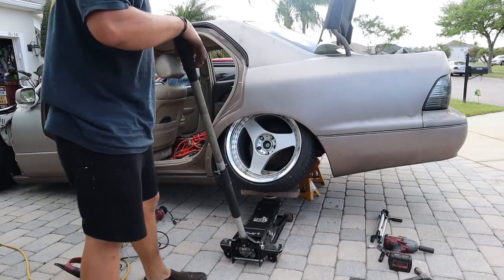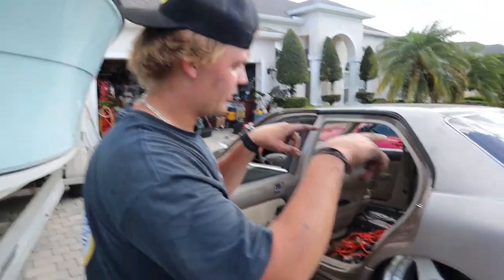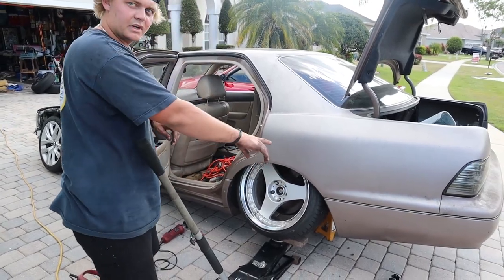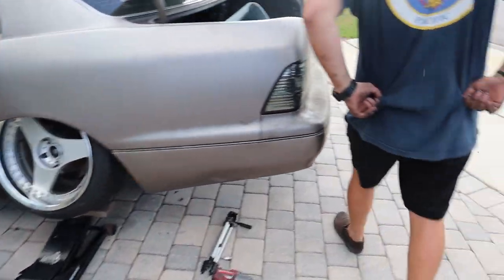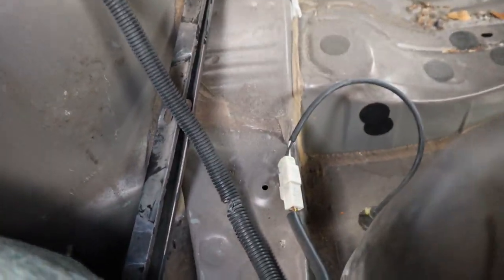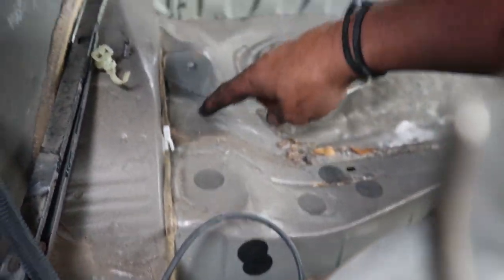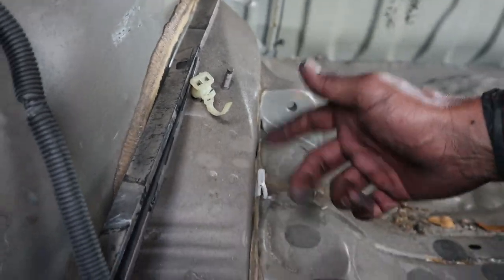Test fitting, kind of. I mean, that's how it's going to sit. When I notched both sides, the way that the rear upper control arm sits, one sits higher than the other. The one that's hitting closer is the right side — the back one. When you raise it up, the left side is not hitting but the right side is, and it's barely hitting though. But I'm still trying to go lower. This notch right here is right where it cuts. So if I were to basically cut all of this out where the seam sealer is, I'm probably going to end up just cutting this out and notching up some more. And then the upper control arm will kind of sit right there.